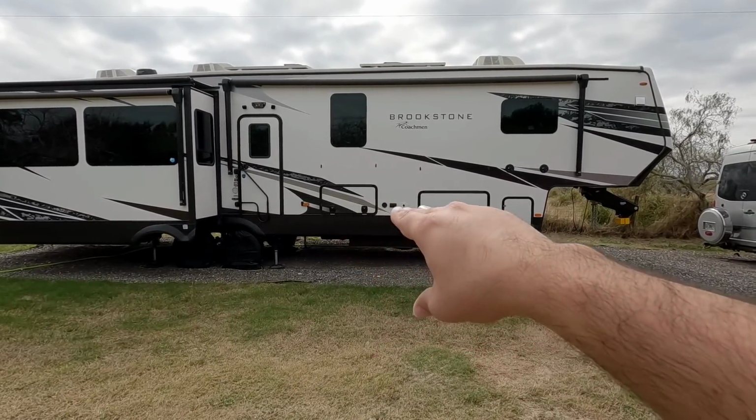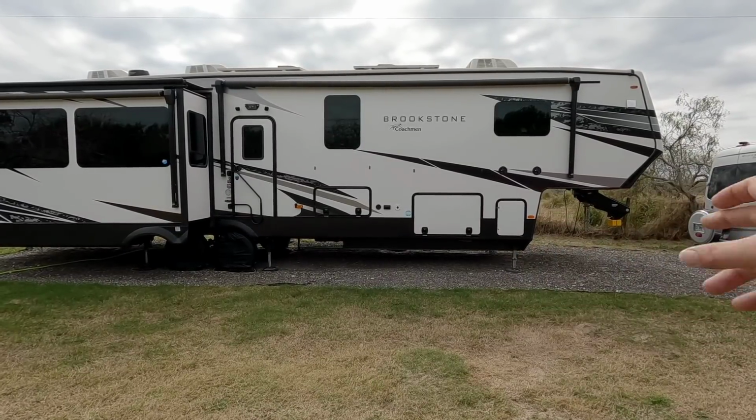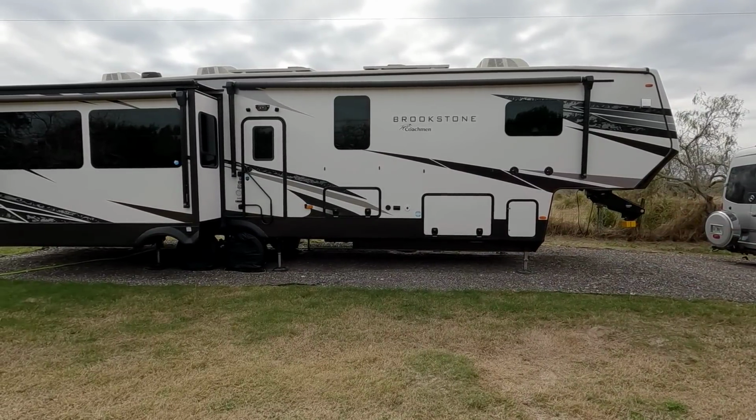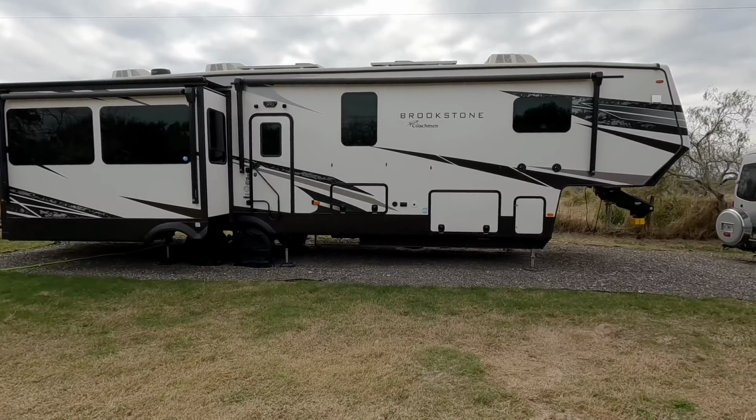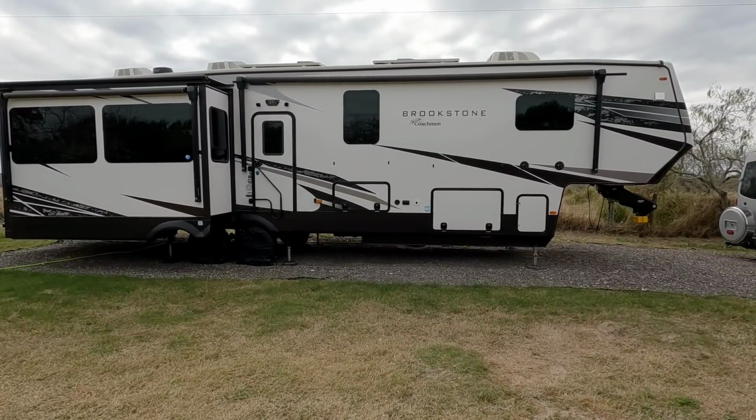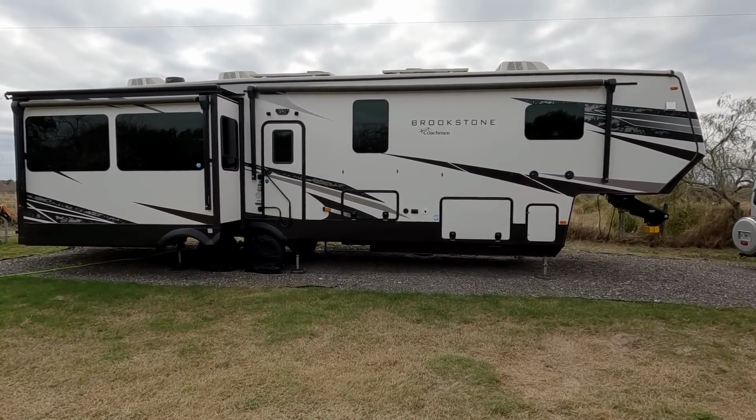I'll lay the straight line edge of the graphics down, and then I'll squeegee it in place. I might put a little bit of soapy water on the other side of it, kind of like you would with tint. That way you can move it around a little bit without it forming air bubbles that you can't get out. And we'll see how it works.